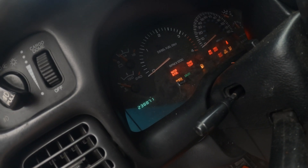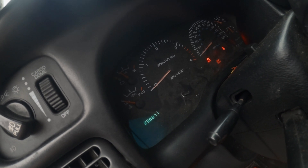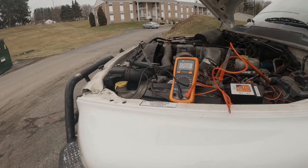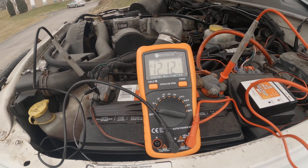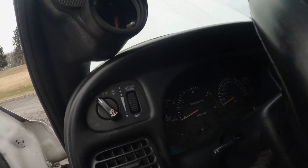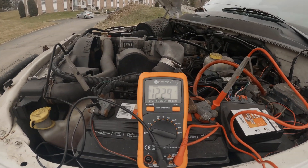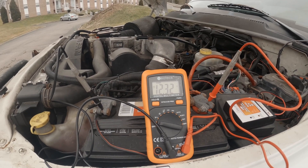You can see the yellow light is on, so it's actually actively charging even though it's February in Pennsylvania and there's no sun up. If you let the glow plug cycle — or the block heater intake cycle — you can see the voltage drops down. Then key back out, it's off, and yet the voltage is climbing back to a fully charged battery.